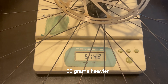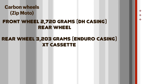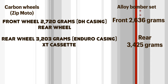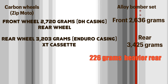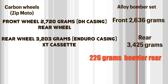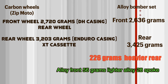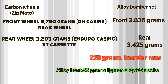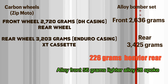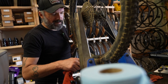The affordable aluminum front wheel comes in at five pounds fourteen ounces. Heavy-duty carbon rims are barely lighter than aluminum. Our aluminum bomber wheel set is about 226 grams heavier on the rear, and that is mostly cassette weight. Super interesting note: my alloy bomber wheel set features a 28-spoke front wheel and it actually comes in lighter. Both have downhill casing Assegai front tires and enduro rear casings. And I know people will say carbon wheels don't go out of true as much — but my bomber wheel set was built by a local wheel builder who really knows his stuff, and they've never come untrue in over two years and 2,000 miles.